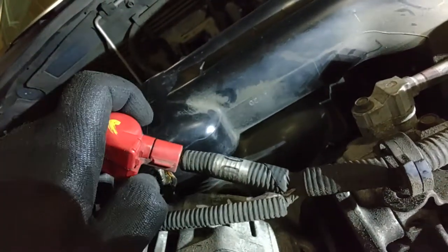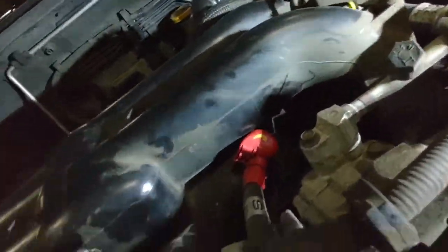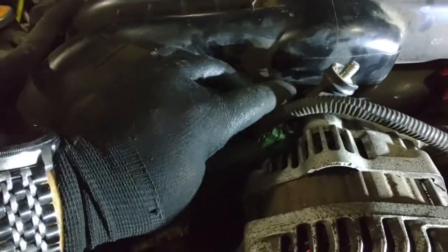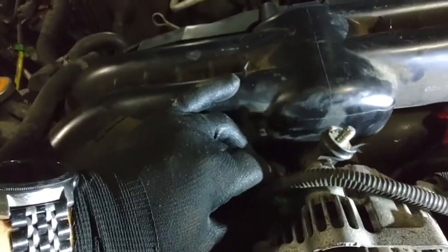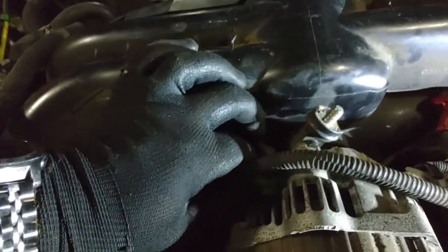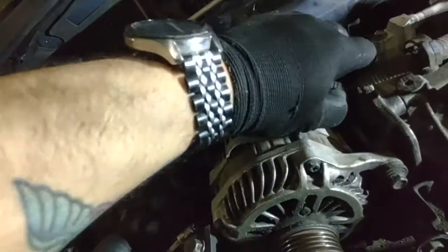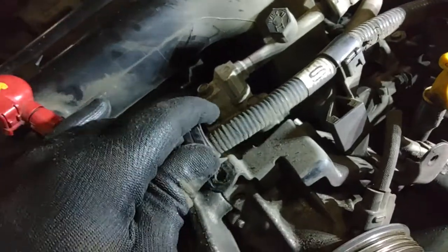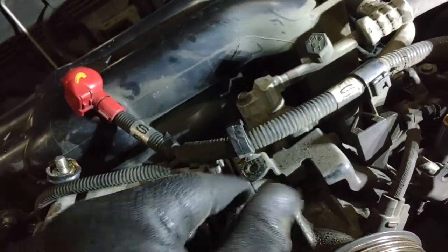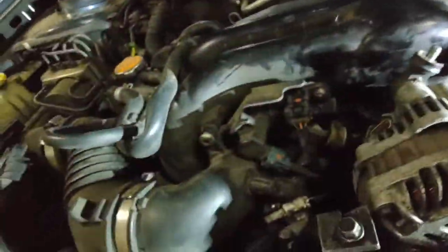Luckily this has a plastic intake so it can't short out. Here's your control wire — this tells the alternator when and how much to charge. On the back side there's a push pin connector; squeeze it and pull. Mine was really stuck and I ended up snapping the push pin off with pliers — so that's gone now. If yours is still intact, it's a standard expansion clip with two little fins on the bottom side; use pliers to squeeze the fins and pull it up.